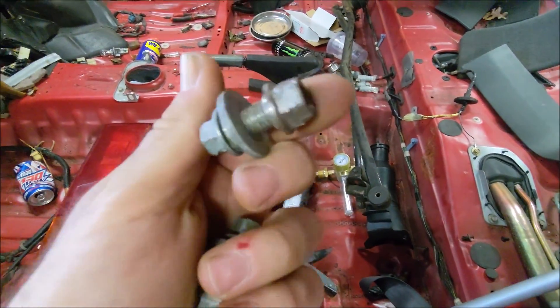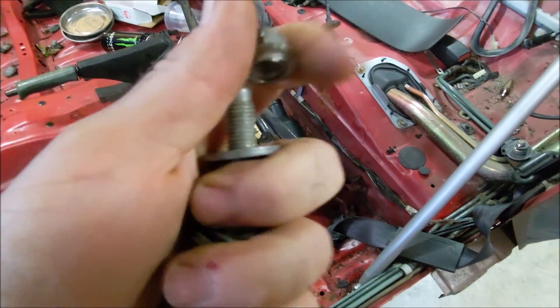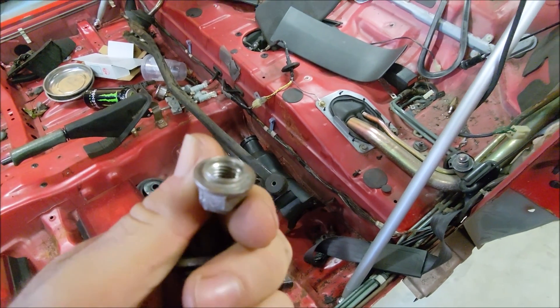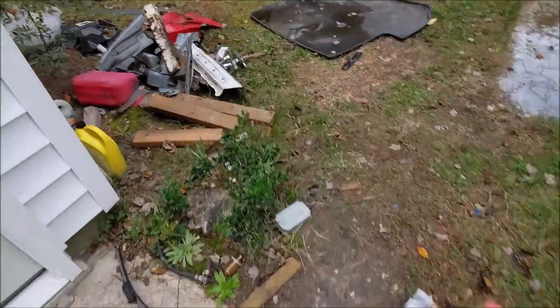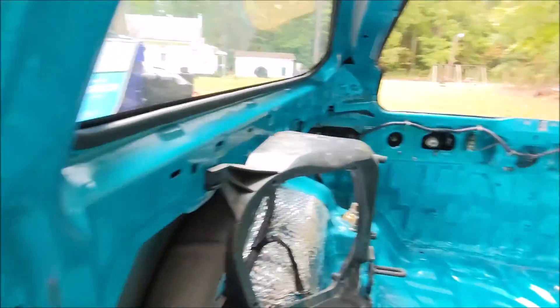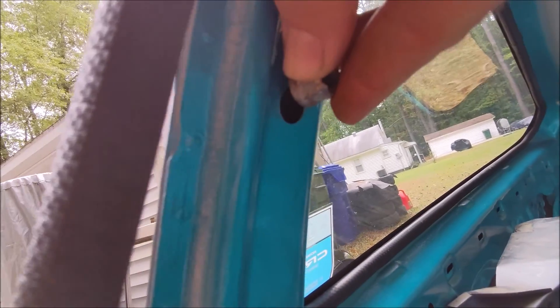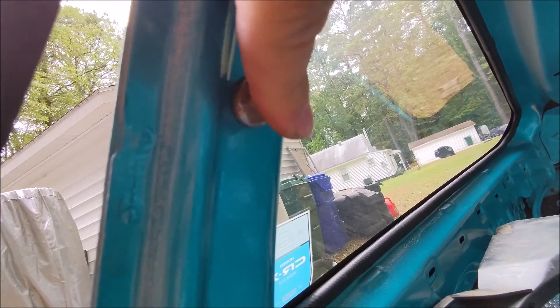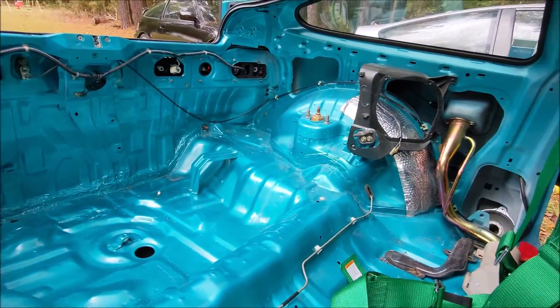What I found is these nuts which are actually used to hold the struts on, and what you do is take a little washer portion off of it — that leaves a pretty nice ridge there. On the door-mounted style they have a hole in the frame, they just don't have the nut in it, so after you take that washer off it actually sits pretty well in that hole and that'll center it to some degree. So I'm going to go ahead and sand this down, weld this in on both sides, and then we'll have mounting points for the harness bar.